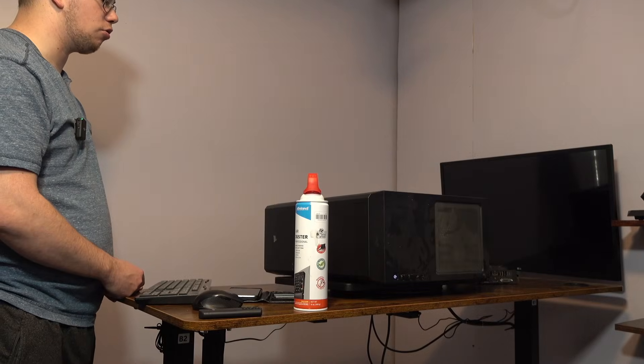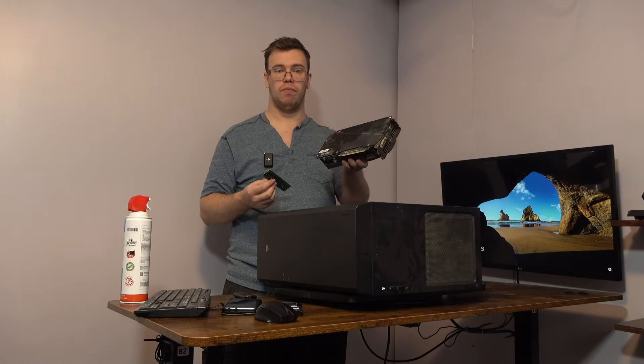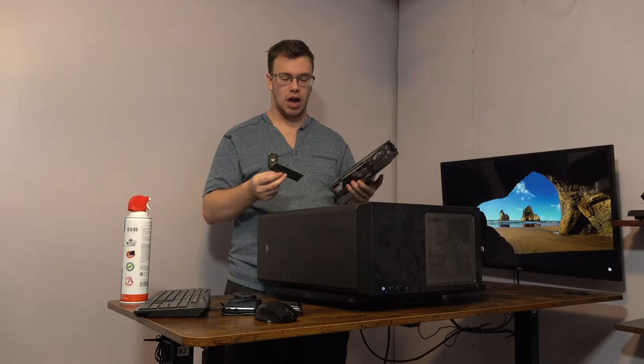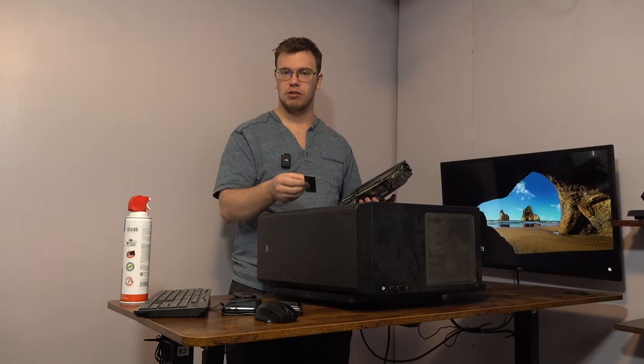Okay, we got into Windows. I'm 90% confident our culprits are: the GPU's HDMI or something is wrong with it, so I think that's bad. And the other thing is this RAM stick — I think it's faulty because it's not working anymore. It also seems like the motherboard's two and four slots are bad on his board. So looks like it's two dead components, plus a bad board.